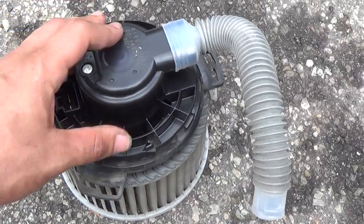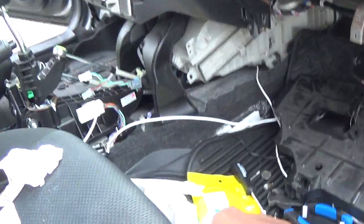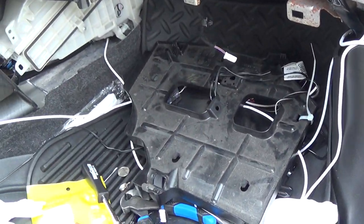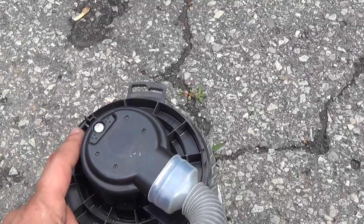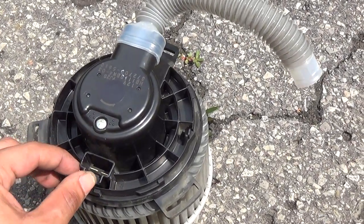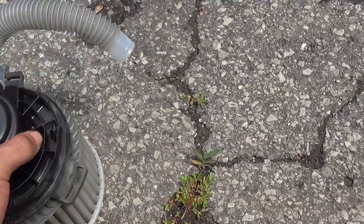So that's how you take out the Mazda 3 fan. Take out all this junk, take out this cage here — that's the air intake for the outside. Move it, and once you have access, go around and press and rotate. You'll see that when it's installed the plug is right in the corner, but when you rotate it'll bring the plug down so you're able to push the tab and pull the wire out. That's it — thanks for watching, subscribe and like.